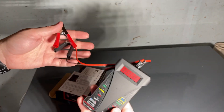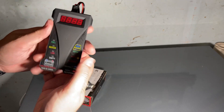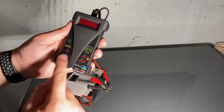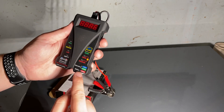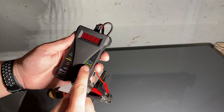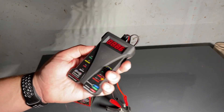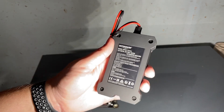It's not currently connected, but we're going to connect it to a vehicle. It says Motor Power open circuit voltage, state of charge: empty, low, full — so this is going to be for your battery side. Once the vehicle is running, this is going to be more for your alternator side: high, good, dead. It'll tell you if it's either dead or reverse.